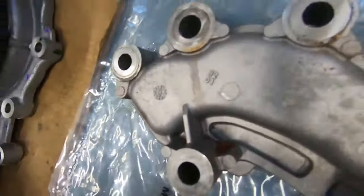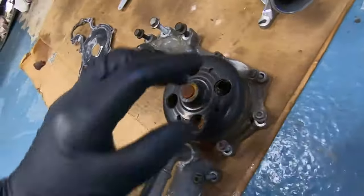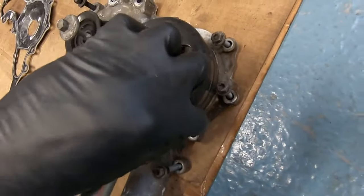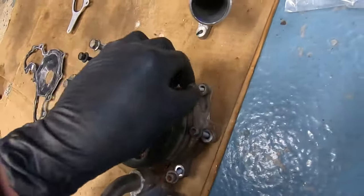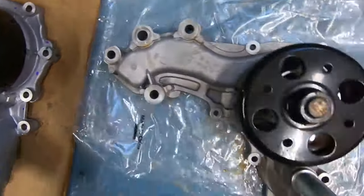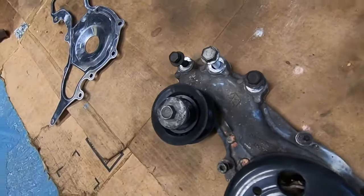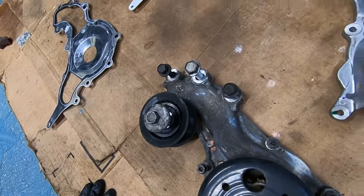A couple things to note before the install: there are 12 bolts total. The four on the outer right edge have rubber grommets — make sure those are pushed up on them. I didn't put any RTV on those the first time and had no leaking from them. The only leaking came from the weep hole failure and from that 15mm bolt. So I'm going to put a bit of RTV around all three of the big bolts — the two 13mms and the 15mm — right where the washer meets the bolt head.